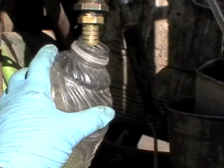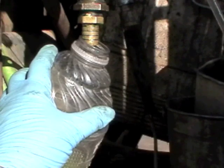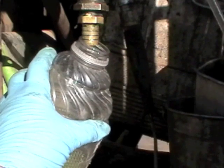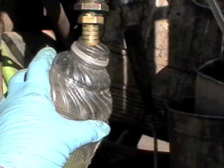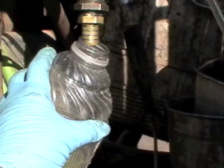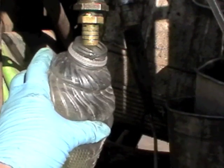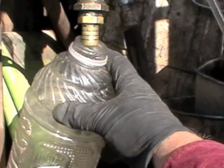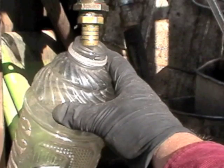2 days ago I collected 18 gallons of a locally made biodiesel B99 from a fuel station, and then I added 2 gallons of gasoline on top of it, and I noticed right away that there were precipitates forming. It sat around in my settling tank for 2 days, and now I'm going to draw off the first collection of precipitates and let's see what we get.